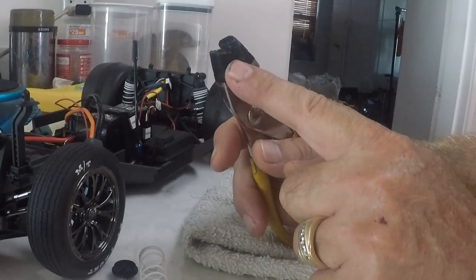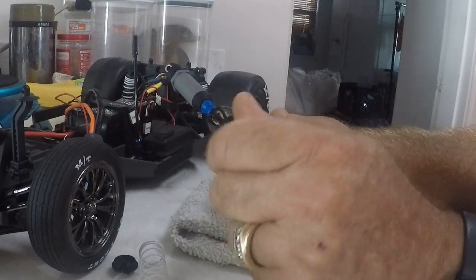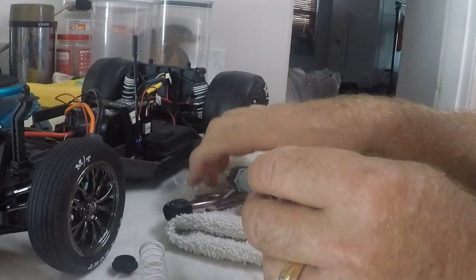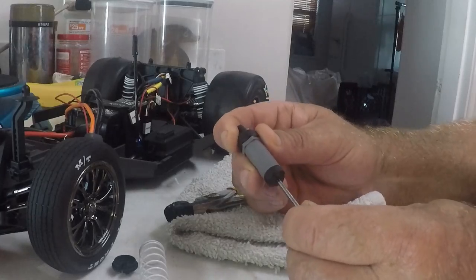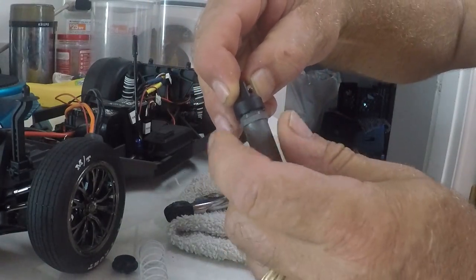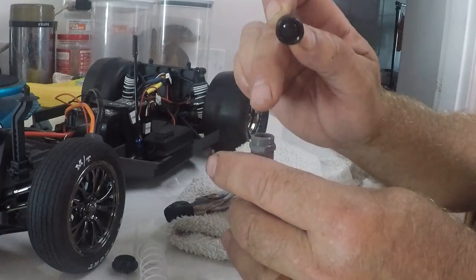First thing you want to do — I took some black tape and put it around my pliers so you can hold on to it. Squeeze pretty tight, not too bad — just hand tight. That's from the factory like that. Then you take that and set it aside. It's got these dampers to stop you from bottoming out, but they don't have anything to stop you from topping out — that's the problem. Especially on drag slashes. So I'm going to take this top cap off. I popped it by hand — it has a rubber gasket in there.